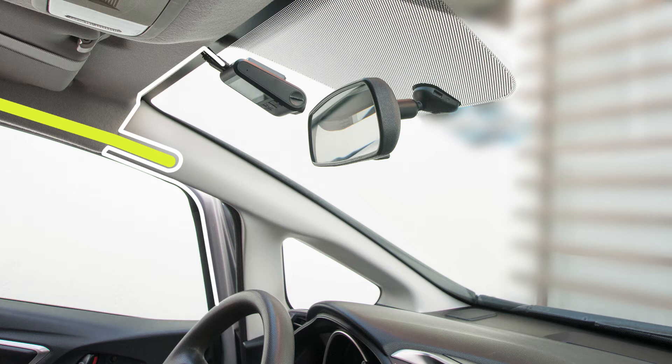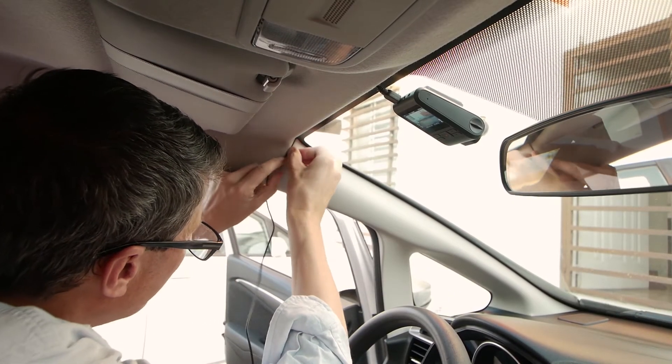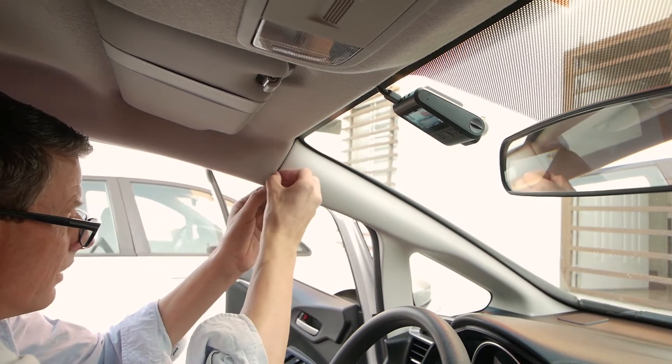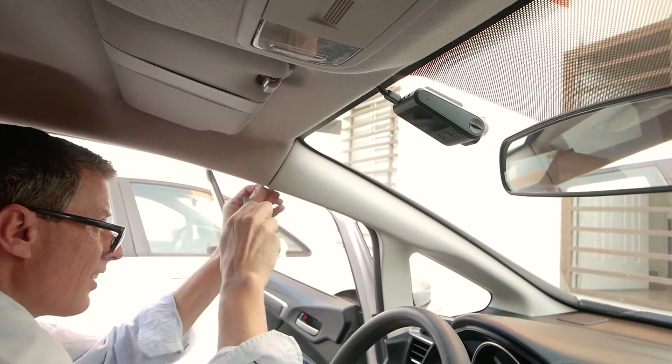In this image the airbag is yellow and the power cable is white. The dash cam power cable has to go an alternative route so the airbag won't be obstructed during deployment. Back to my install with no side airbags — a bit more force is needed inserting the cable here, which is where the interior trim tool comes in handy. You should be able to do this without lifting or removing the A pillar plastic trim.